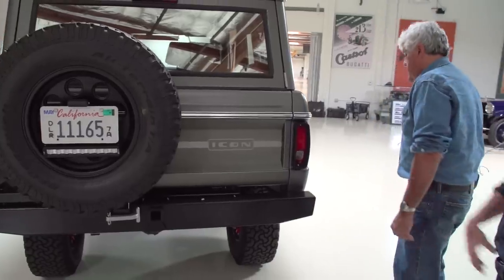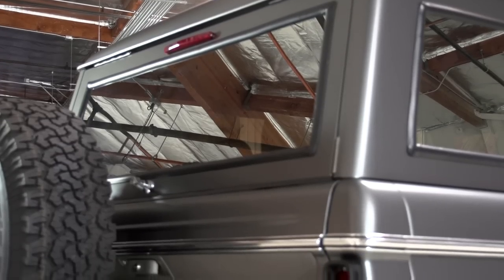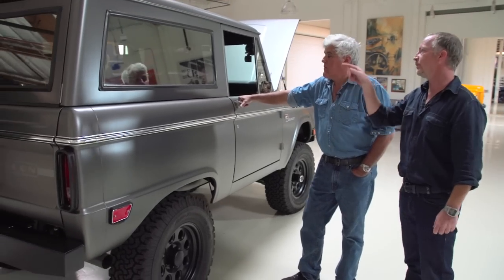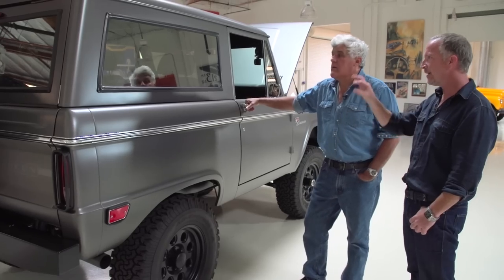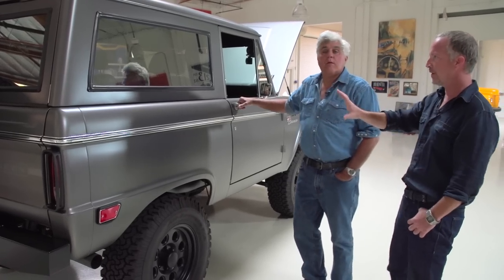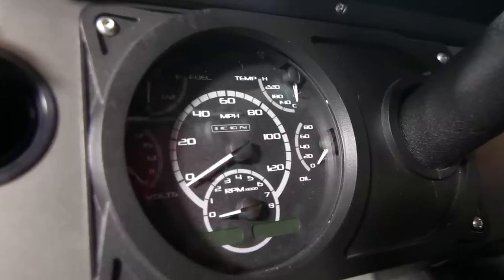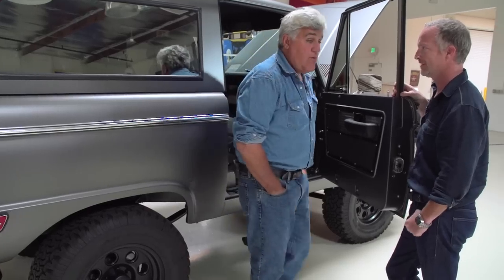Boy, that's a nice detail. And then the glass is another weird detail — that's actually architectural glass you'd see on a skyscraper with a reflective coat. What we do is CNC it and then temper it so it's appropriate for automotive use. It adds to this monochromatic funkiness of the truck. All those dash panels are CNC'd out of stainless. We actually partnered with Nike and Ford on the development of this truck — they have an insane machine shop.